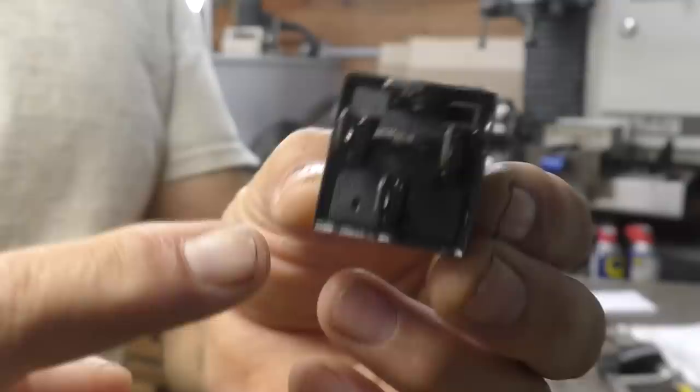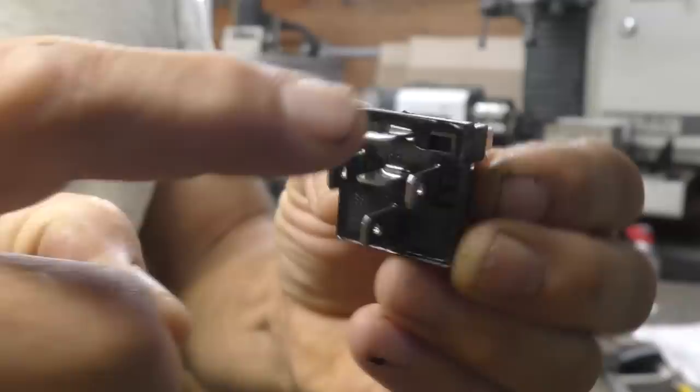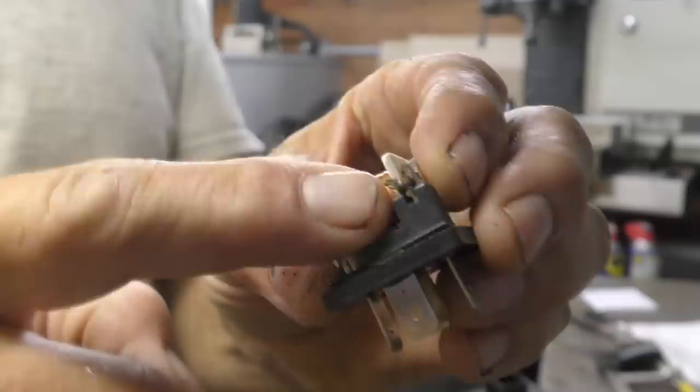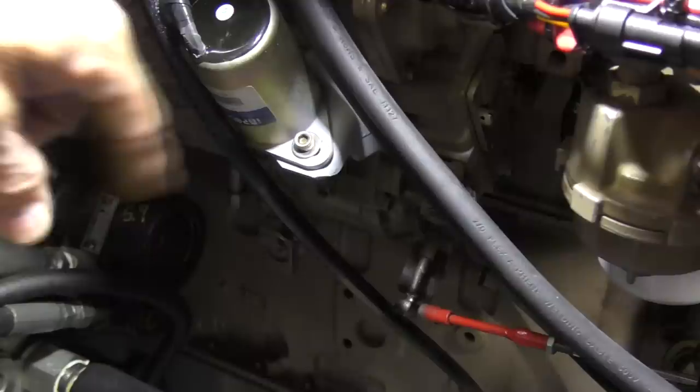The question is whether it's the 24 volts doing that or the collapsing current off a coil. My guess is it's the collapsing coil voltage - I didn't know about it, somebody put it in the comments. When you put 12 volts across the coil it makes the magnet, closes the switch. I'm sending 24 volts across these contacts and that's why they welded shut. The other coils are the contactor for the starter - a big coil - and the fuel solenoid coil, which is also a magnet that yanks up and turns the fuel on or off.